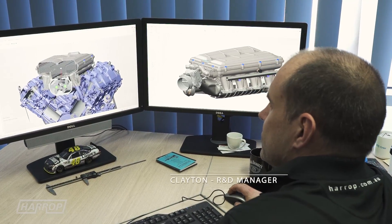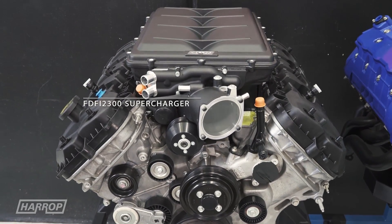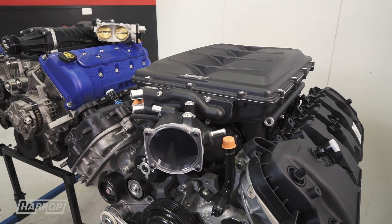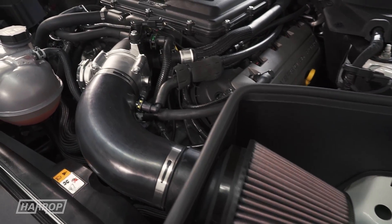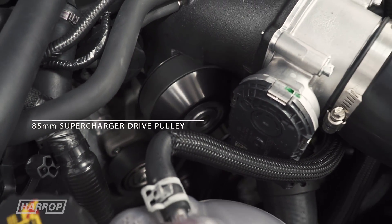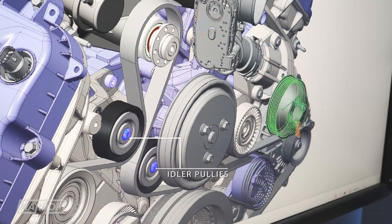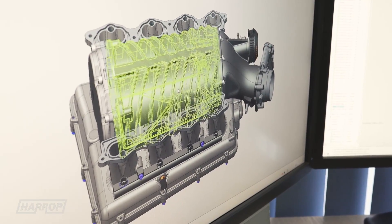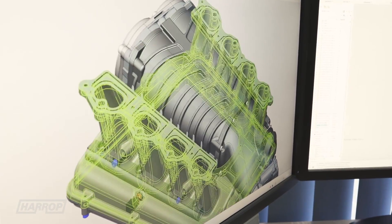Clayton, our R&D manager, has utilized our front drive front inlet — FDFI 2300 — supercharger for the Coyote, recognizing that it is capable of supporting a standard engine through to built motors with forged internals for extreme performance often expected by our customers. For standard installations the drive pulley supplied is 85mm and uses a longer 6pk belt supplied using the factory front end accessory drive assembly and additional idler pulleys to achieve optimal belt wrap. The supercharger is inverted to enhance overall packaging on the quad cam V8 configuration and maximize the intercooler system that we will cover shortly.